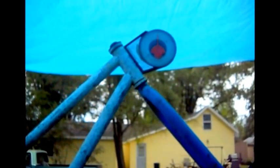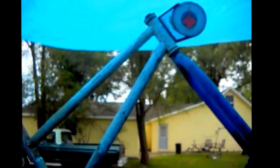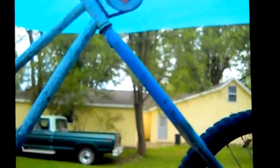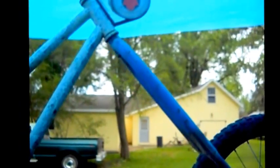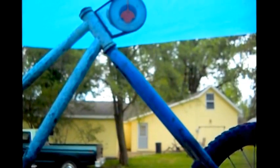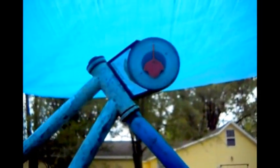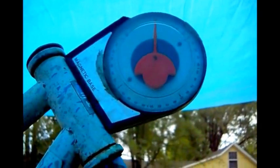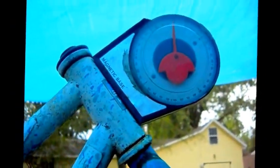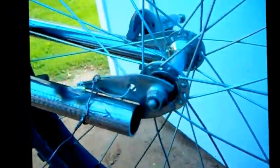I'll put this in here real quick — I like 55 degrees. When I bend that back it'll be 55 degrees. These forks are factory-bent and I really don't like that when they're made that way. You'd think they wouldn't be that strong, but it depends how big they are. 55 degrees — I use a magnetic angle finder.